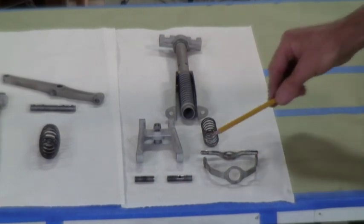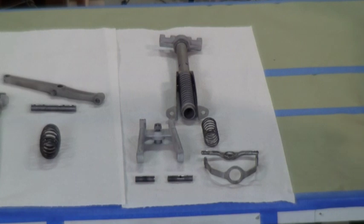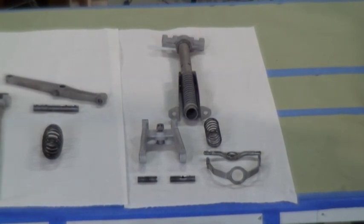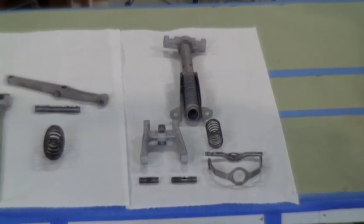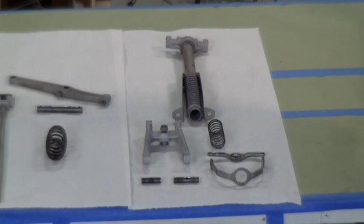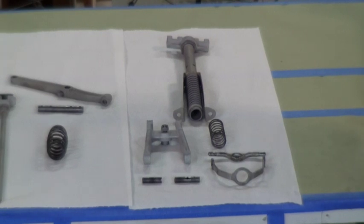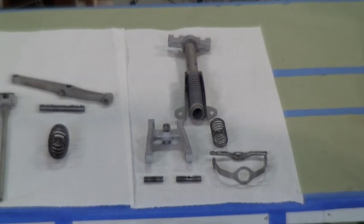This yoke assembly and bar is part of the Miller modifications to the OX5 valve gear. A chap called Leslie Miller came out with a much better valve gear system for the OX5 which increases the RPM by about one to two hundred. That doesn't sound much, but bear in mind this engine only runs at 1,400 RPM, so that meant quite a bit more power. Blue Swallow Aircraft are actually rebuilding this Miller valve gear so operators of the OX5 engine will be able to benefit from this modified gear designed in the 1920s. Now we're going to the engine to show you the valve gear working.